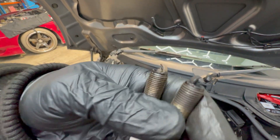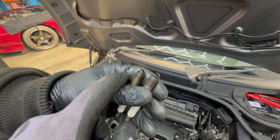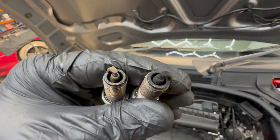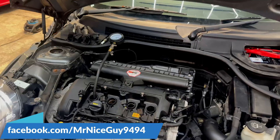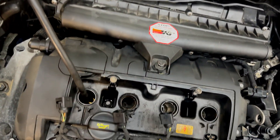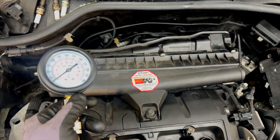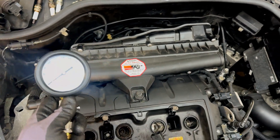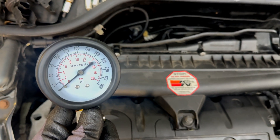Can you see the difference? Not much on the camera, but the left one, which was in cylinder 4, is wet and this one is dry. You can see the tip as well — it's more like carbony, and that one is wet from fuel. The compression test is hooked up — basically it's a gauge connected with a hose to the spark plug hole. So I'm going to ask Dan to start the car. Obviously it won't start because it doesn't have the spark plugs and coils, but we will see the compression.